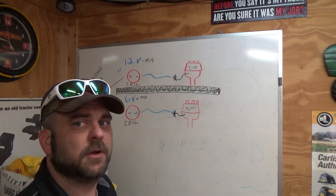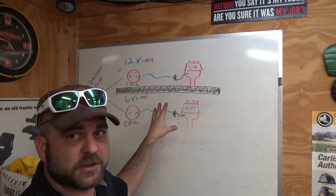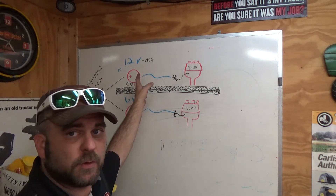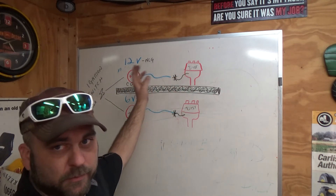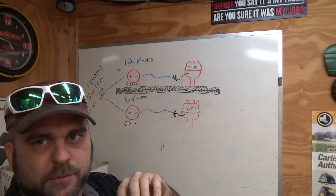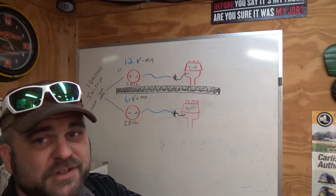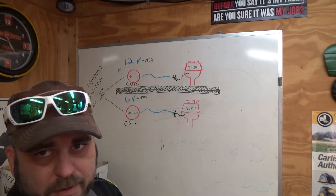Primarily these round coils — whether you have a 12 volt or a 6 volt ignition. So if you've converted from a 6 volt over to a 12 volt, you're going to look at what's on top. Front mount distributors on Fords that have the single wire going to the coil — this won't make much difference unless you've converted to 12 volt, in which case you're going to switch the polarity on the wire.